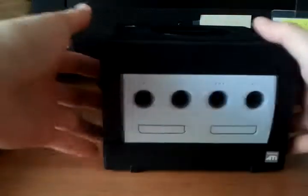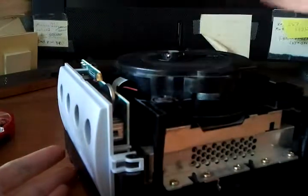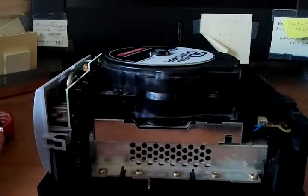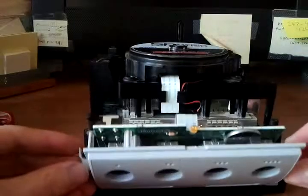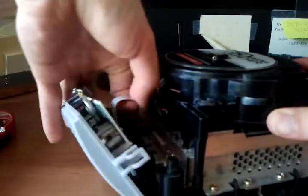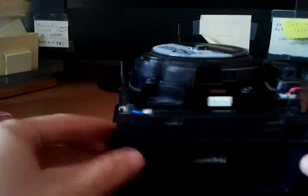And finally, the moment of truth - there you go. I would suggest when doing a teardown, always keep a disc on the drive itself so that you don't scratch the lens. You want to take the top panel and pull it out, but don't pull it all the way out, because there's a ribbon connector right here connecting the game ports and the backup battery. Just gently pull the tab and you can pull it right out - it's just a friction fit.